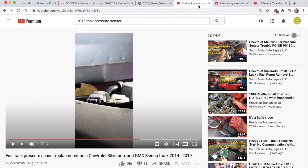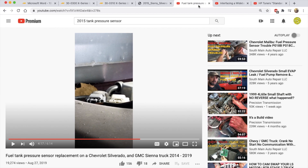It's super easy — probably one of the top five mods I've done to my truck. The way I did mine, I don't even have the wideband gauge mounted where you can see it; I bundled up the wires and zip-tied it under the dash. If I want to see the wideband data I just open HP Tuners, or look at it through the Torque app on my phone — I'll append a video showing how to set up the Torque app to display the same data using a Bluetooth OBD reader and an Android phone.